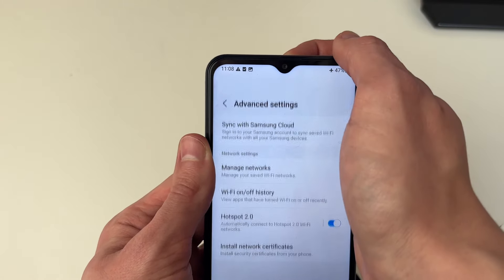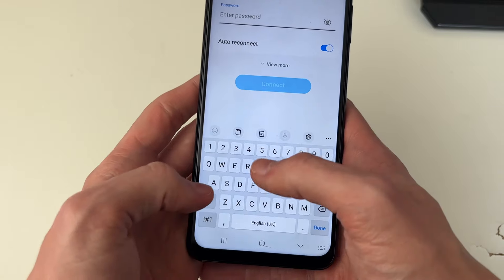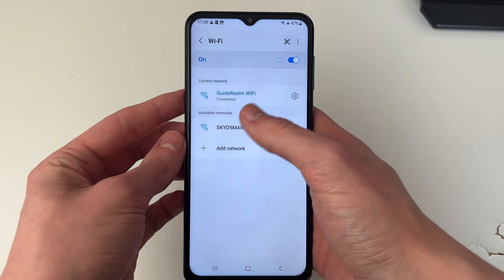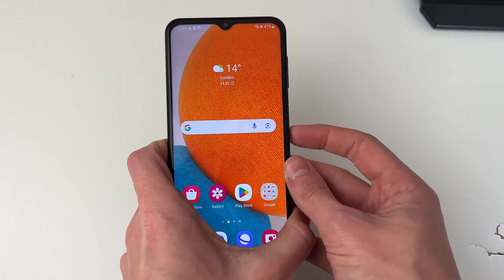For me it's the guide around Wi-Fi. After you've selected it, go and click on forget at the bottom. Then press back and back again, and wait for it to appear in your available networks. Click on it to rejoin, enter the password, and click on connect. Hopefully it should now successfully connect.